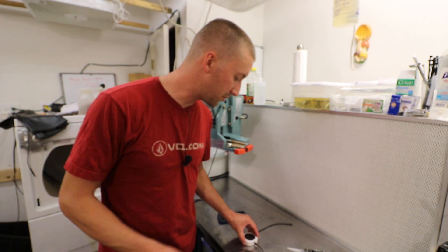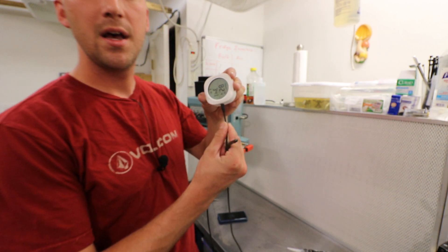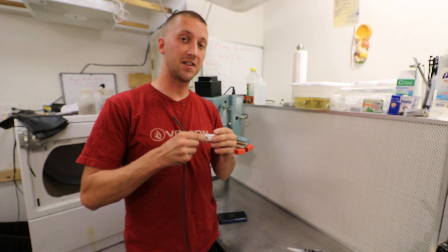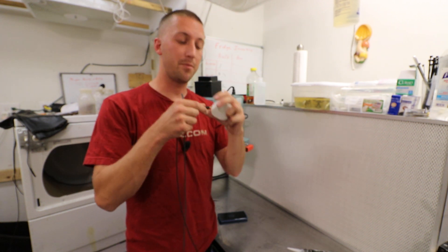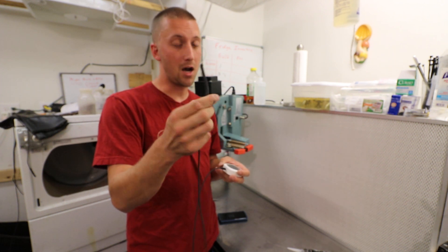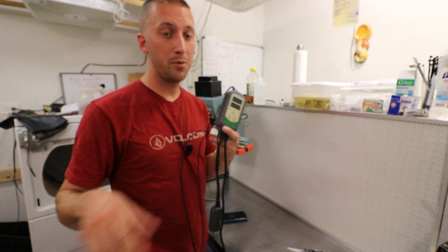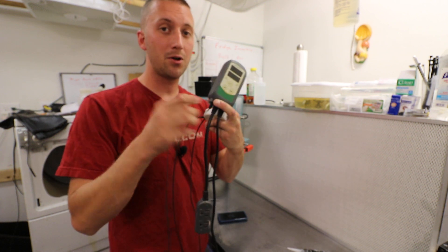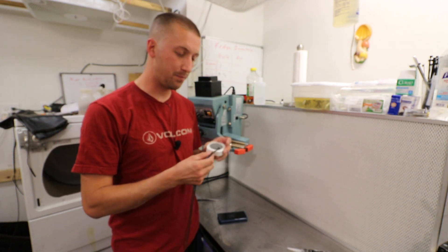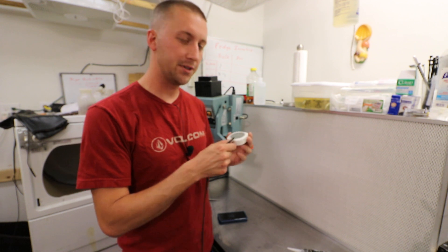The TH1 Plus has a pretty long, about six-foot extension cord for the probe, and it's also detachable. That's nice because if you need to fish it through something you can unplug it, fish it through, and reconnect it. Also, if the probe ever conks out you can replace it. With older Inkbird temperature controllers the probe is wired in — you can't just throw a new one in; you have to replace the whole unit or manually wire a new probe. It's a big bonus that this one is detachable.